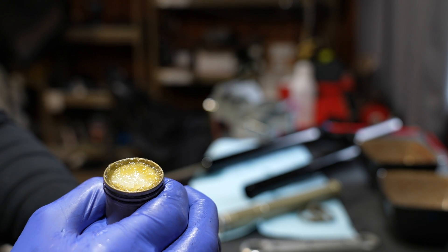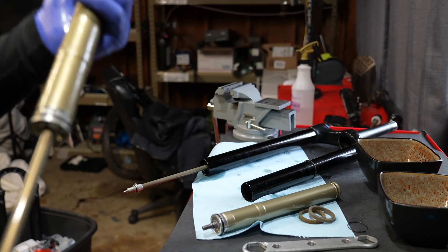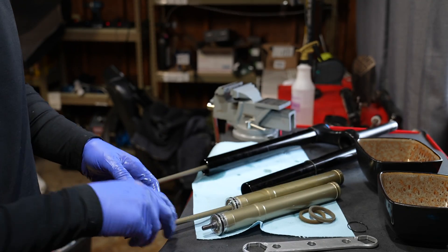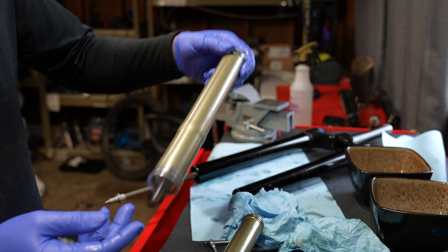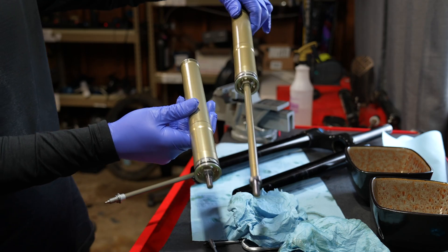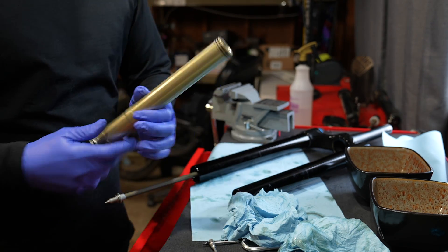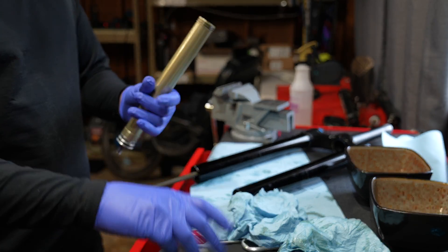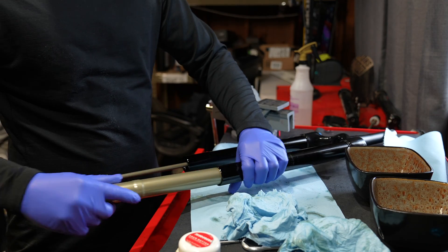To pull the air piston assembly out of the rod, you have to torch the bottom and it takes a little bit of work. It's not fully required to change the travel because we're just gonna swap a whole new cylinder in there. Here's both air springs — one is in a stuck up position and one is in a stuck down position. Just get a light coating of grease on the O-rings on the outside of the air spring and pop it in the fork.